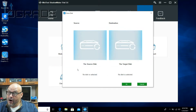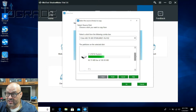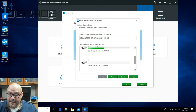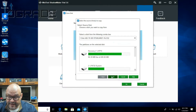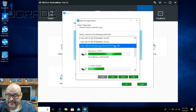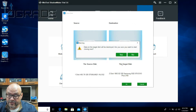We're going to clone our hard drive right now. It's asking you to identify the source — the source is going to be our C drive. If you can see, the C drive comes with a couple of different partitions, and this is where you're okaying everything to proceed. I can see everything's copying properly. We're going to say finish on this one, then go to the target.